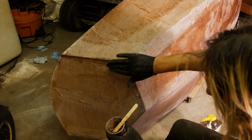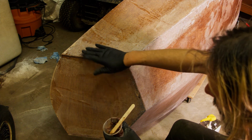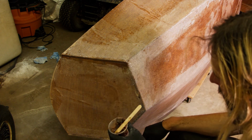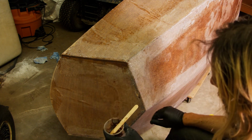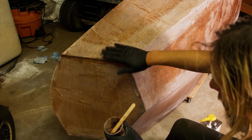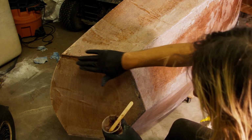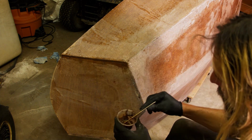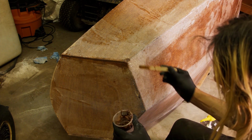The other thing is that a lot of my air bubbles were caused by this being a very sharp break here. And so I want to try to do what I can to round this out before I put on the next layer of fiberglass, so I don't have that strong, sharp angle to try to get over. Now, I'm not sure that there's really any way I can put this filler in to make it nice and rounded, so probably to round it, I'm going to put stuff in and then come back with a little sander of some sort, probably the random orbital sander, to try to round it out. But anything I can do to make things more round during this filling phase will certainly make me happy later.